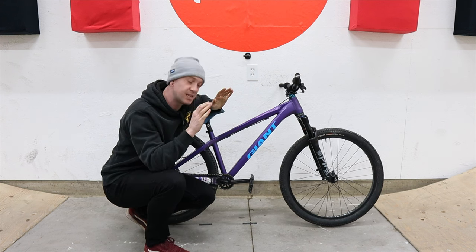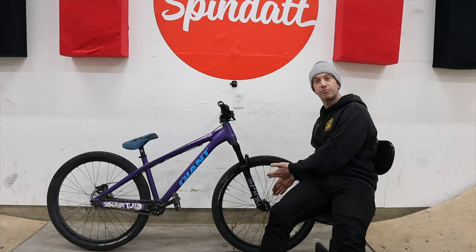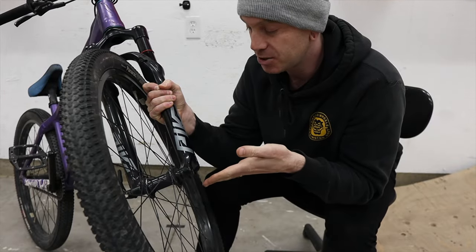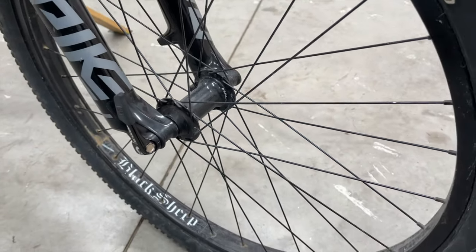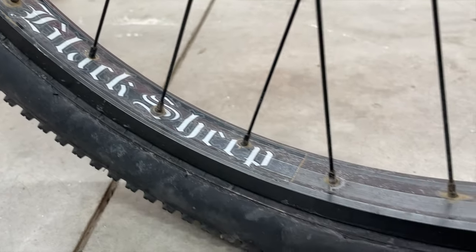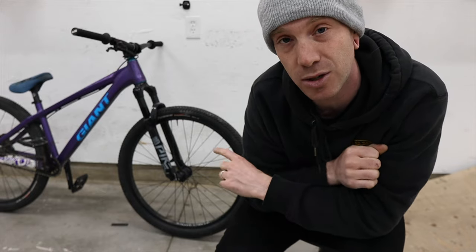The last thing I put the most thought into was the wheels. The stock wheels have provisions for a brake rotor up front, narrowing the flange width there, and because it came stock with gears and a derailleur, the rear hub has a freehub body — also narrowing the flange width. I knew I'd never run a front brake, so when Matt Jones kept talking about the Halo Wide Boy hub, I loved the idea: it's basically a BMX hub with a through axle, offering a wider spoke brace angle for a tougher wheel. I ordered one and built it up to an Alienation Black Sheep rim, keeping as much BMX DNA in this dirt jumper build as I could.